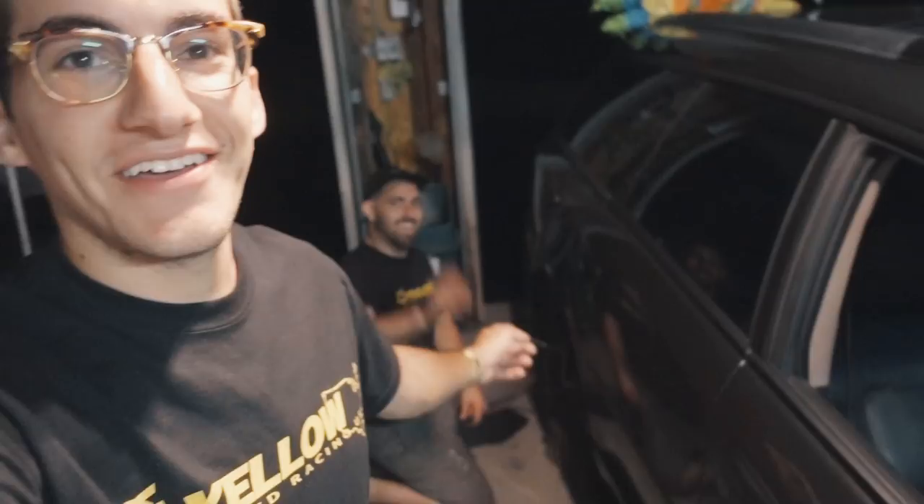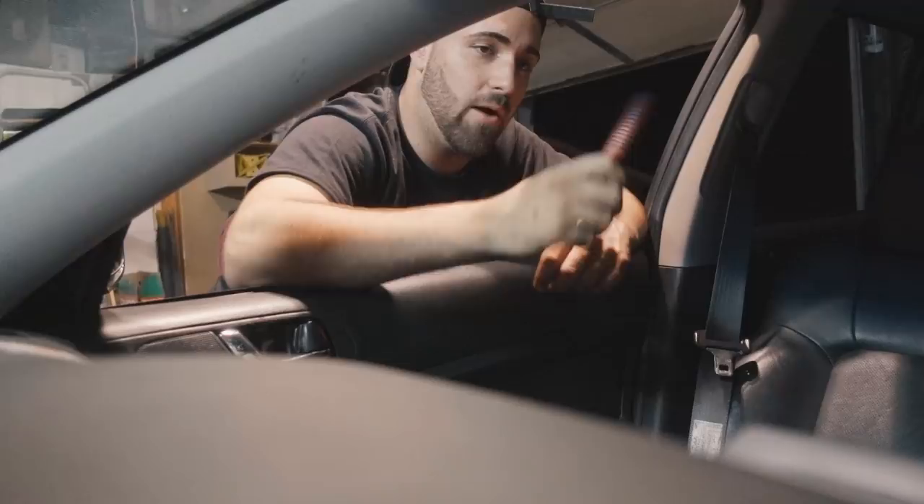We're back — it's a little dark out, I just got back from the graduation party. Cody got all the brakes on while I was gone, which is awesome. The next step in the process is to bleed the brakes. I'm gonna be in the car pumping the brake pedal and we're gonna replace the old fluid with new brake fluid. You start from the furthest one from the master cylinder, which in our case is the passenger rear outboard bleeder, then inboard, then driver's side, then passenger and driver's side in the front.